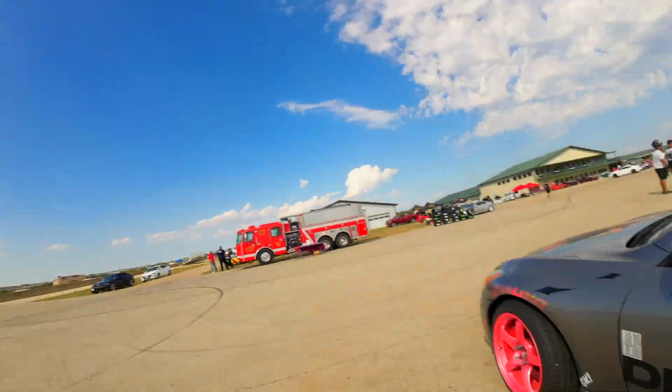Alright, what's up everybody? So I got some on-car footage, got some helmet cams. There's only one more session right now, but I have a new problem. This track is extremely fast, so it's right on the edge of being, like, I can't push the throttle any further into the floor in second or third. So I'm keeping it that way and running about 60 PSI in the car. So it's getting hot about every couple of laps.